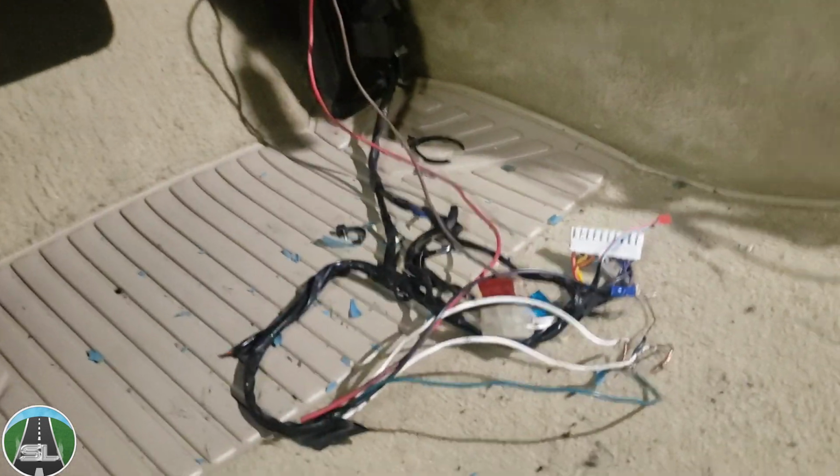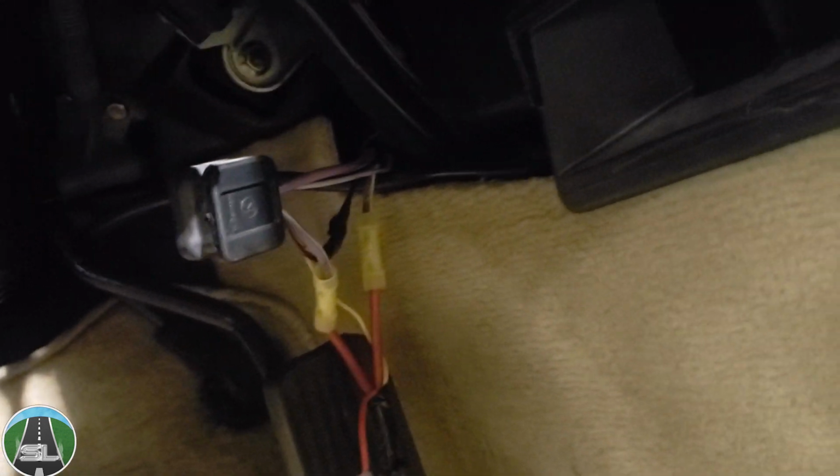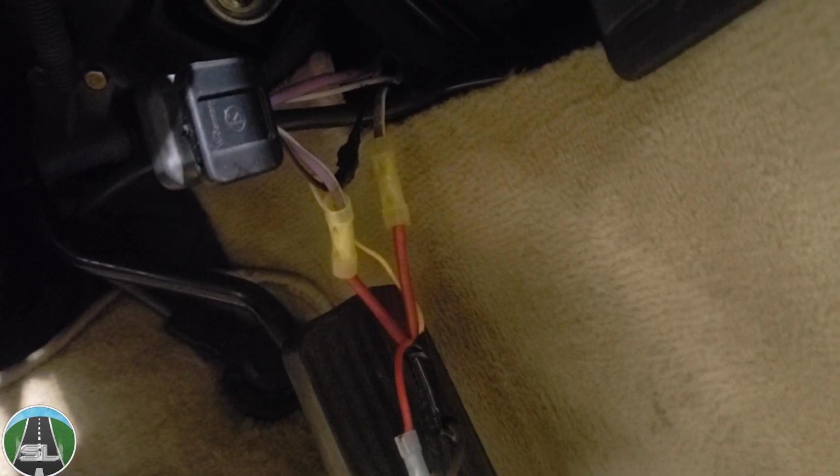The main point I want to make is, number one, the black tape that you see was at different spots where the alarm was connected. There's a piece back here I had to cut from. I've got to address that. But the bigger issue was I unplugged that plug just recently. I believe I have to take those two purple ends and reattach them to each other to go back to OEM, because they're still attached to the wires that run down to all of this mess.